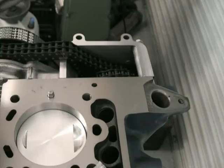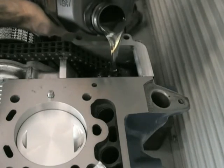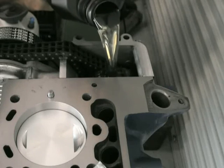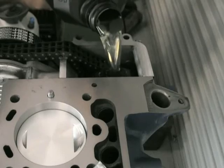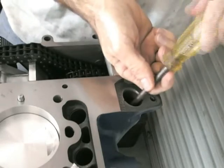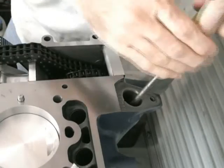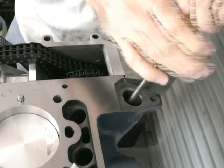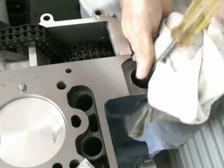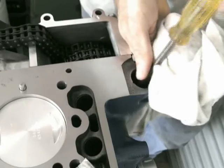I usually put oil in as I'm doing here. It's a good idea because you really want to make sure you prime up all the oil lines before the head goes on and the drive shaft for the oil pump. You'll see in a moment I put a screwdriver where the oil pump drive is and I turn it a number of times before the oil actually fills up the oil lines, the oil filter and so forth. And you can imagine if you didn't do this how many revs your engine would do before you actually get any oil anywhere.